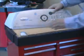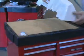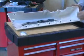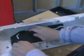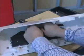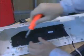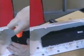Carefully pull the knob off the control shaft. Turn the console on its face for access to the user interface control. Unhook the user interface wire harness from the cover clips. Then remove the 3 screws from the user interface board cover.